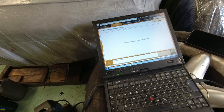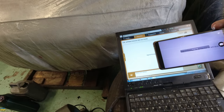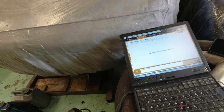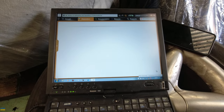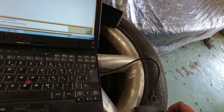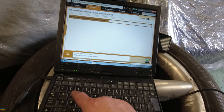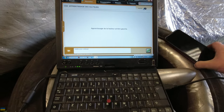Now it's asking me to go to the other side. I can't read French — I've just got a trick app on the phone. It's looking for R2 and H2M now — exactly the same thing just on the off-side front. I've done all the radiuses already: 317mm in it goes. Now I'm measuring the H reading on the off-side, and then it's going to ask me to go to the near-side rear.